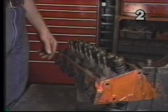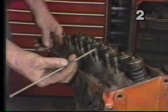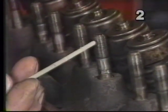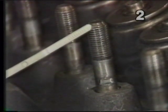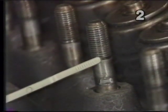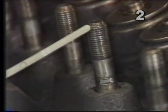Now let's take a look at the rocker arm studs. We want to check for overall condition. First, we're going to look at the threads. The threads should be in good condition, and if they're not, we have an option. We might be able to just chase the threads with a proper threading die, or if that doesn't prove to be successful, the stud must be replaced.